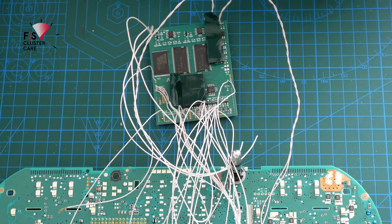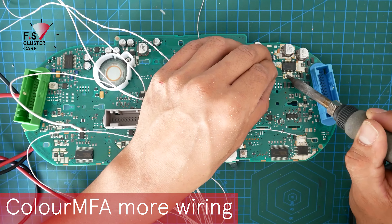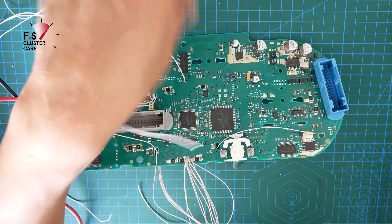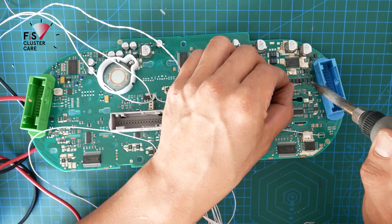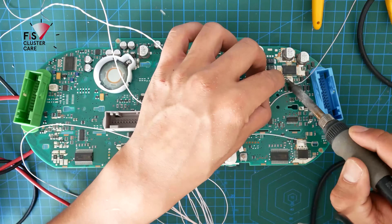If you're still with me, well done — you're past the halfway point and might want to take a break. The next part involves wiring up all the components from the rear of the housing onto several places on the motherboard, so lots of cutting, snipping, stripping wires, and soldering is involved. Give yourself a few hours for this — the Audi TT ColorMFA installation has a lot more connections than doing this on a Golf. Make sure you're following the wiring diagrams accurately and take your time to ensure nothing is damaged when you first power up the board. All wiring diagrams and resources are linked in the description.